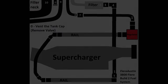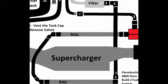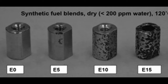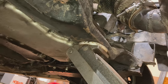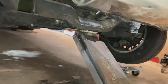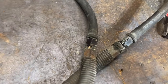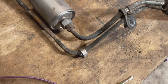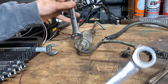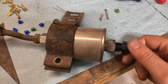Now it's time to modify my fuel rail system and replace all of the hoses. A diagram of all of the wiring and the fuel rails are on a forum post in the link in the description. Ethanol also reacts with aluminum, so choose your fuel system components wisely. First, chock the front wheels and then jack the back of the car. You can use the jack point on the rear engine cradle and then put some jack stands at the jack points in front of the rear wheels. Go ahead and replace your fuel filter now with just a couple of 10mm fasteners. In my original setup, I utilized the rubber hoses that existed in the OEM setup, but since we're going to ethanol fuel, I'm instead going to replace these entire lengths of rubber hoses with new push lock material that's ethanol rated. I'm going to get rid of all the steel tubing except for the steel tube going into the filter from the tank. You could get a high flow filter at the expense of not being able to filter as small of particles out.